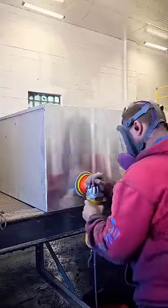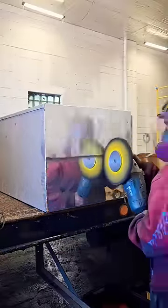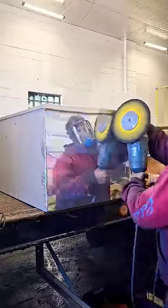Lastly, we're going to put a foam interface on and a 600 grit, and we're going to take all of our final scratches out. Here, we're using the Jackson Lee Cut buff and our brown compound that we call Scooby Snack. We're going to cut this panel a couple of times here to get all of our sanding scratches out.